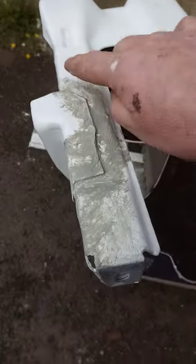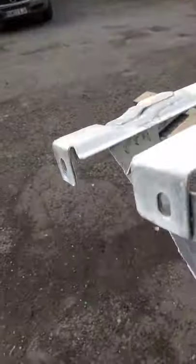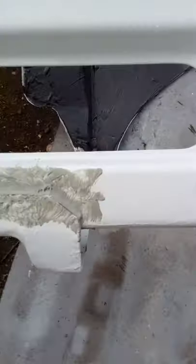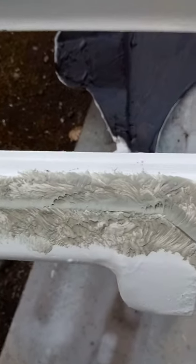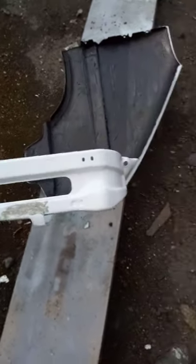I put some seam seal around about any welded areas. Can you see that? Again, the light's really going bad now. Any place where the manufacturer had welded stuff together, there we go. There's one line down here. I put some seam seal on it. Am I bothered that it looks like a mess? No. All I'm trying to do is protect it from getting rusty again.